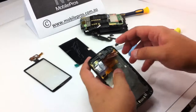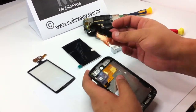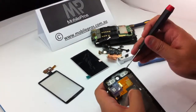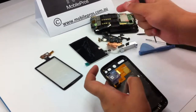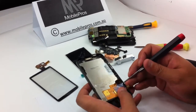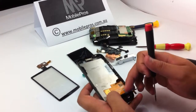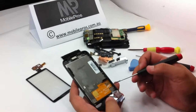After you peel to the end, lift up the bottom cable, and then the front key. Now peel off the little plastic attached on the LCD cables, and after that separate the digitizer cable and the LCD cable.